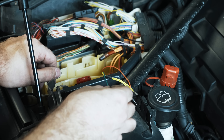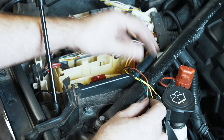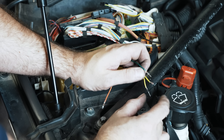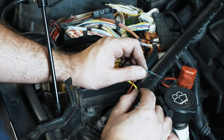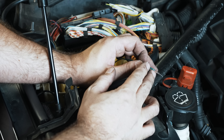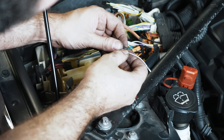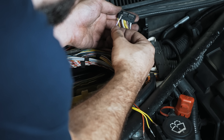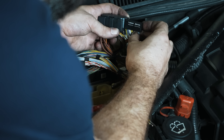There seems to be a manufacturing issue: the green wire has a male pin connector, but it needs to go into pin 16 of the smaller black connector — and a male won't go into a male. I'm guessing they made a mistake. I have a spare wiring harness so I'm going to take a female pin and splice it in — I got the exact same color wire. Back at the connector, I'm inserting the wire I made into pin 16, counting 14, 15, 16, then reinserting it into the connector.